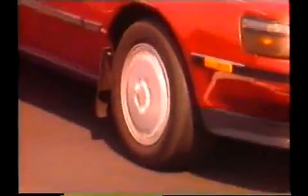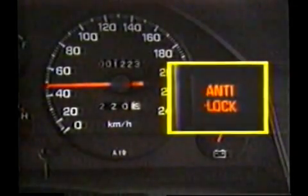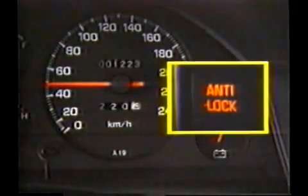During this road check, when the warning light is out for 1 second, the computer diagnoses each of the speed sensors, so be careful not to handle the clutch roughly or suddenly accelerate at this moment, as this will adversely affect the diagnosis. If there is a malfunction, the warning light will come on and stay on.